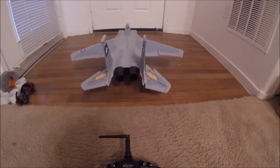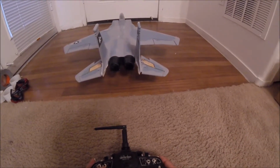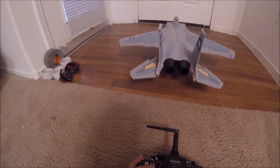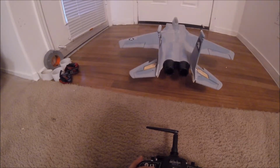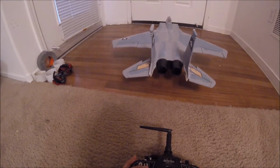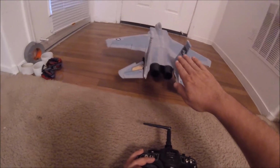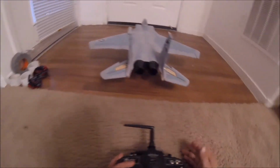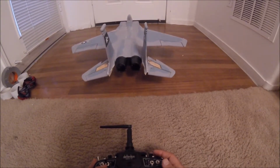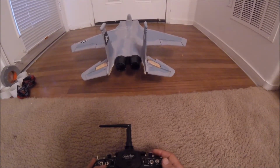Now, how the heck am I going to figure that out? I'm going to have to do trial and error to see which one acts more like a rudder. And then the same thing with the left side. Obviously right now I don't know what the percentages are. I have to look, but obviously these are way too much compared to the ailerons. I think these are going to win. So what's probably going to happen is I'll get a left roll, almost like a flat roll, left roll tendency. And if it's obviously doing that, I know it's not working, because if the rudder's correct, it should actually slightly roll to the right as the rear end kicks the opposite way, if you know what I mean.